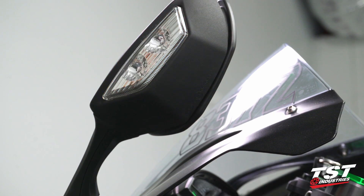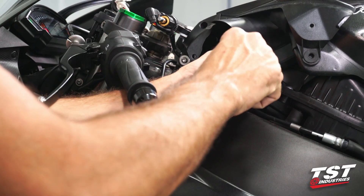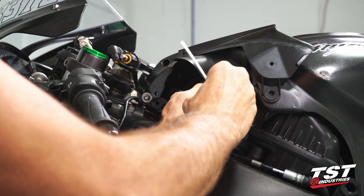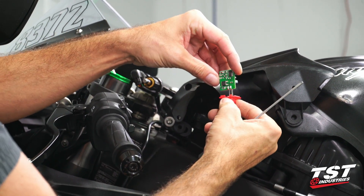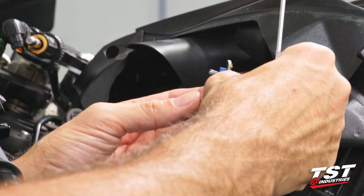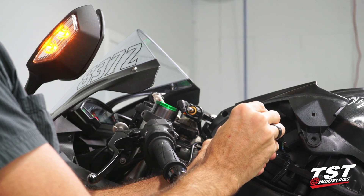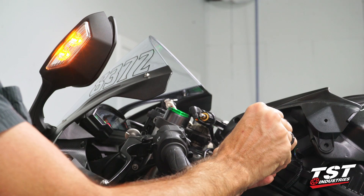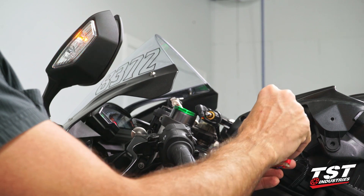So no matter what kind of lamps you have for signals, you will be flashing at 85 cycles per minute. If for some reason you want to get more fancy than just the 85 cycle per minute OEM flash rate, you can slip off this gray cover here. What we're going to do is take out the circuit board and plug it back into the red portion. You can see it's flashing again. So now we'll identify the flash rate adjuster, which is here — the blue piece. It has a micro Phillips adjuster dial. As we adjust clockwise, we will produce a very, very slow flash rate. The opposite effect is a very, very fast flash rate when you spin it to the counterclockwise end.